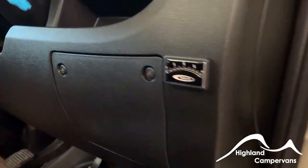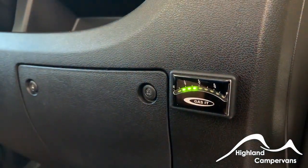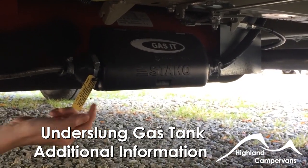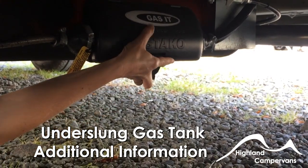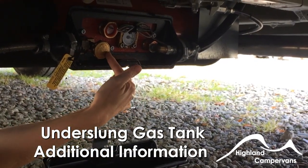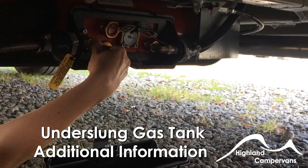Make sure you don't let the tanks run dry. When you turn on the ignition and fire up the vehicle, the display will show you how much gas you've got in the tank. To turn the gas on, underneath the vehicle you'll see a large black box. At the bottom of that box there's a plastic clip — undo that clip and the front of the box comes free. Inside you'll see a brass ring; turn it anti-clockwise to open the valve.